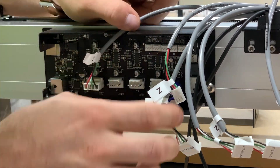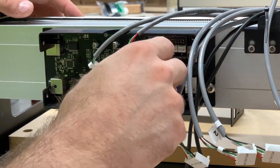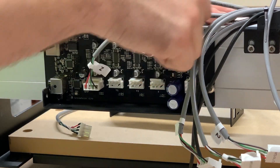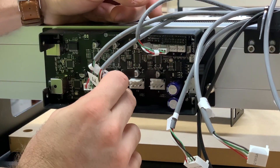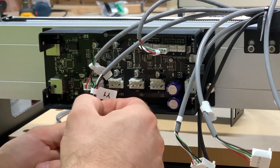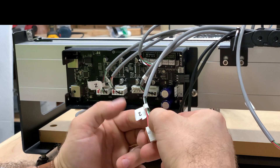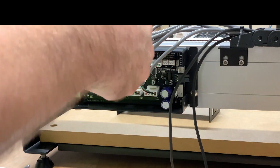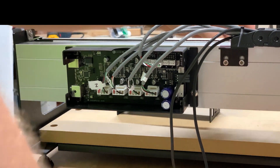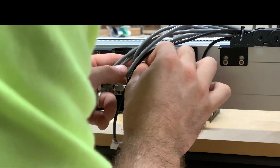Now, remember I was talking about pulling those cables out of the chain drag assembly — this is what I mean. I couldn't figure out why they weren't fitting. I didn't realize you could pull those cables freely inside the chain drag assembly. Once you have it all plugged in, if the top is short and tight, all these cords are supposed to go in through the top and wrap to the right, but some weren't fitting. Just grab the chain drag assembly and pull the cables through before you plug them into the motherboard — it makes the process so much faster. Once everything is seated with enough spacing, push the rest of the cords back into the chain drag assembly — tight, but not too tight, and not too much slack coming out the top. You don't want it flopping around.